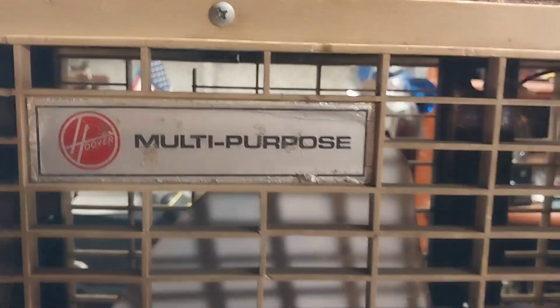There's the Hoover badge again. Here's the back of it — it's a very old McMillan motor. The motor was painted over at some point; I don't know if that was done from the factory or what, but I had to scrape the paint off the tag. It draws 1.9 amps, which is actually lower than the newer versions of these McMillans — kind of odd.